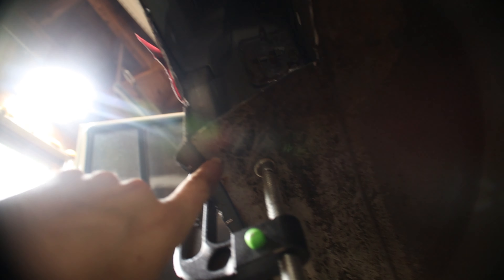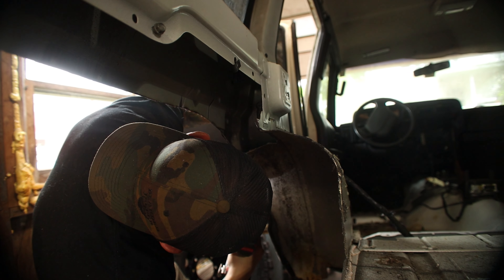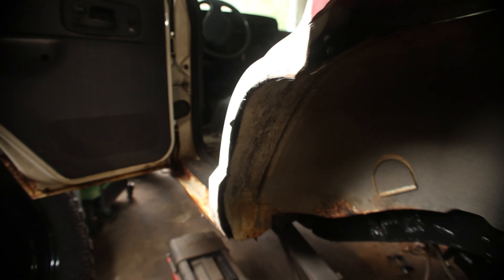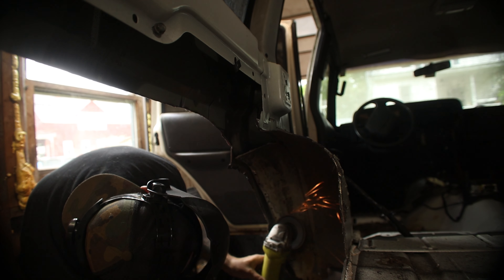I think I've got this to a good spot — cut off all those little pieces that were pinched over. I think I've got enough of a gap here. I'm going to start using the clamps to push this against this other little frame piece here, and then once I make sure I get it all good I'll start drilling some holes, tack weld it into the spot, and then we can start cutting this, fold it over, and we'll have another open fender. We'll be right back.